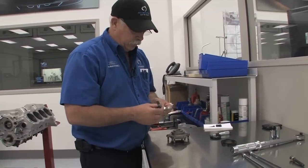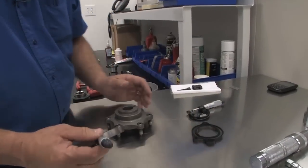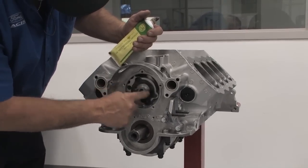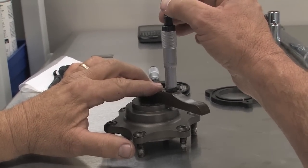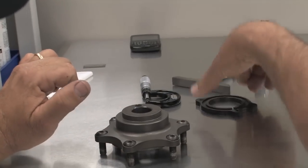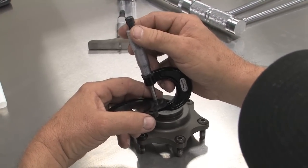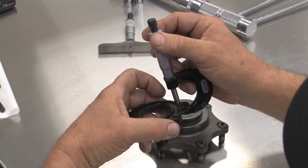The next step is to install the camshaft hub. One of the greatest features of this kit is it eliminates the tedious process of installing shims. It's a good idea, however, to make sure you use one of Roush Yates Engines' CNC-cut cam retainers. We'll measure this — the measurement on that is right at 260 thousandths. Then we take our thrust plate and mic it — it's 252 thousandths. So that gives us right at 8 thousandths of cam end play.